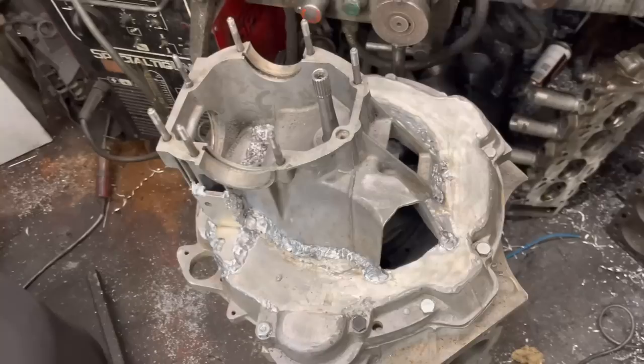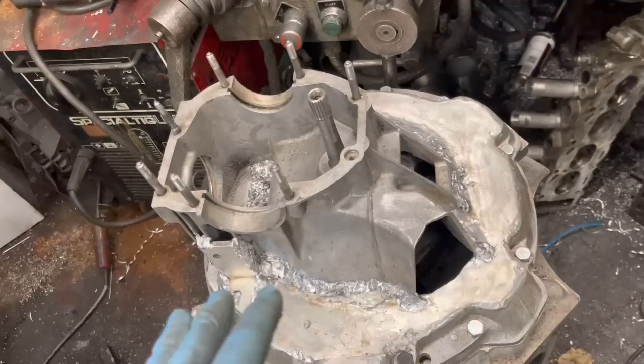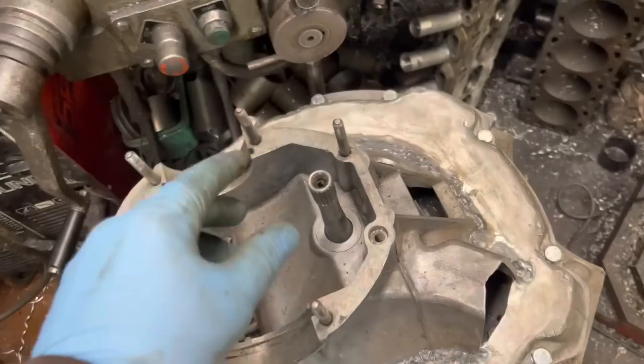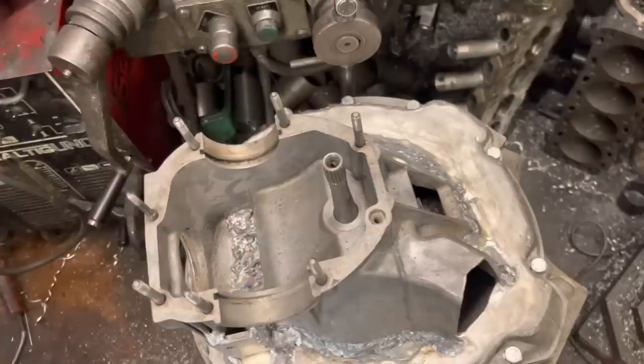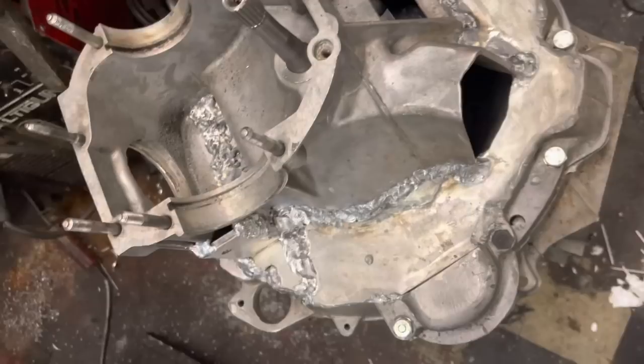On Project V8 Husky, we've had quite a bit of work since the last video because I made a massive mistake. I was using the input shaft in the gearbox to center the whole lot, but because of the muff coupling and the way it all distorted as it cooled down, I ended up with the shaft not being central to the gearbox. I had to grind it all off basically and start again. Excuse the state of my welding - it is solid, it just looks terrible, but we'll tidy it up and blast it later.